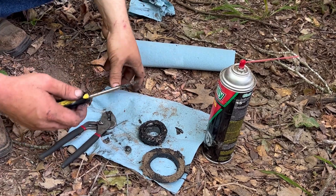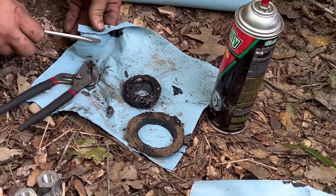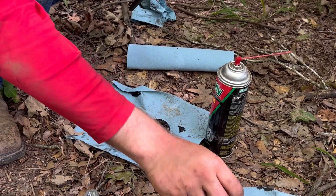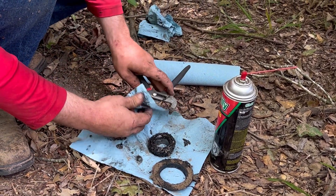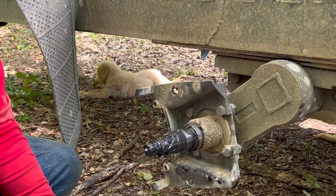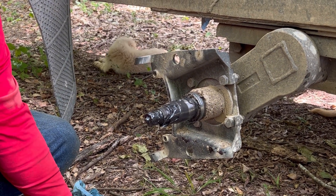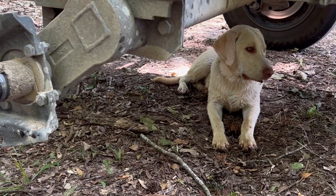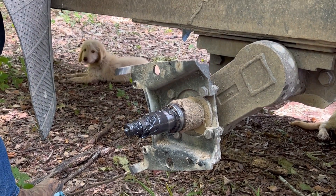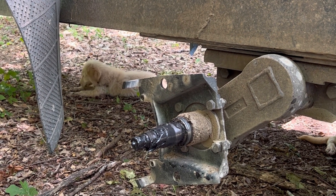Now what we're going to do is clean these off a little bit, then spray that spindle down - see all that dirt on there, it would not be good on bearings. We'll spray it down with brake cleaner and clean it off real good. Then I'm going to take my brake line that's tied up in my frame and get it all fixed up ready for that new caliper.